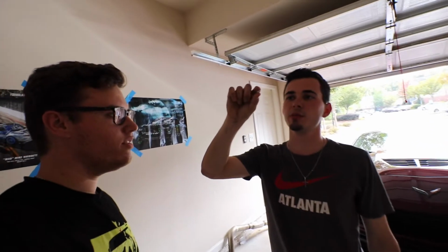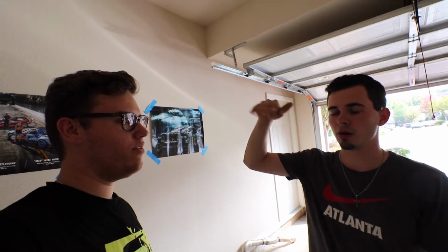This is actually looking pretty good. We did the back like Kevin said, about 62 turns, and that's the max for the back. With these Corvettes, the back doesn't lower too much. There are 2 different bolts. The bolt in the back is pretty much flush with the bar, already cranked down as far as it'll go. The front in a Corvette and Z06 comes down a lot more than anything else. So just the front really comes down.